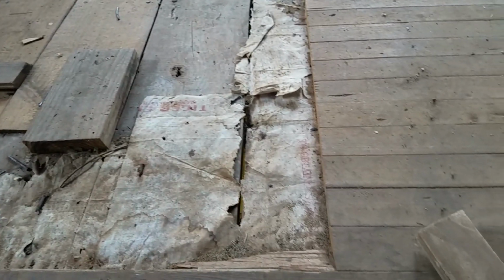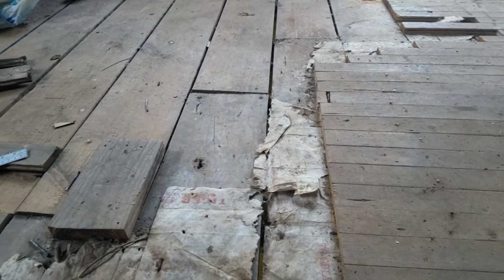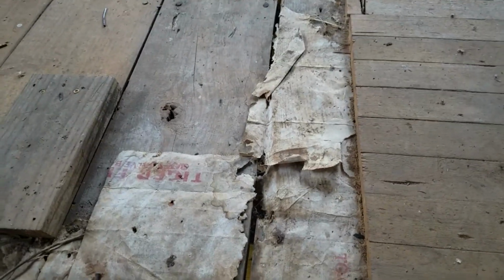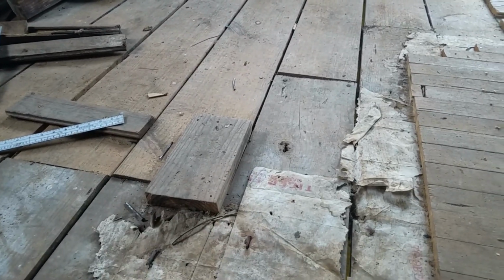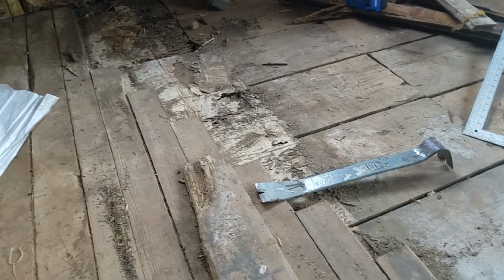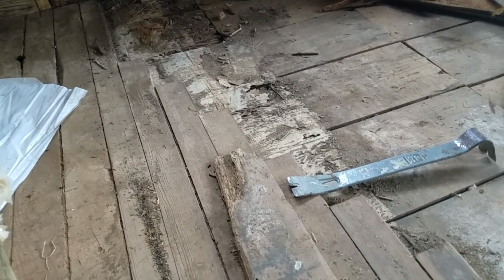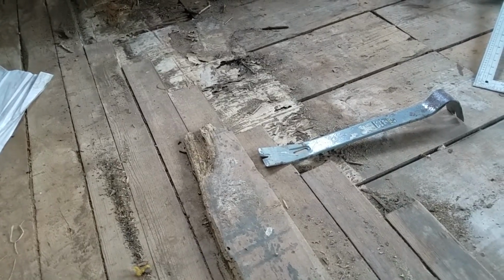Feathering. So when I cut these floors, it's basically right angles. You know, eliminate the rot. This is solid. This can stay. That stuff had to go. But I didn't want to get sidetracked on feathering the floors in. So this was a 90, and as you can see, I've feathered them and given them about 6 inches of overlap right there.